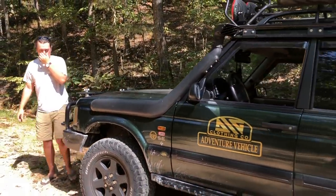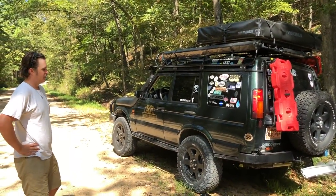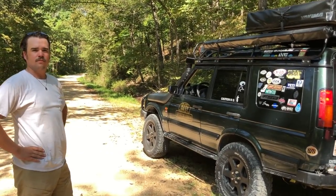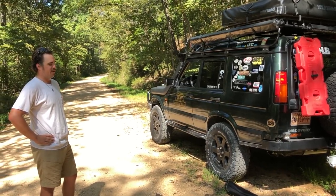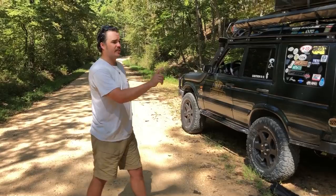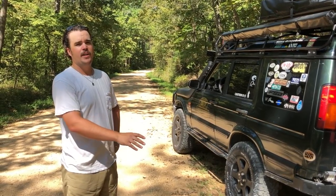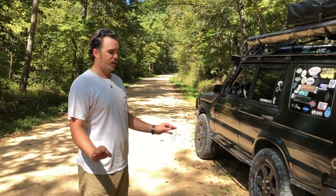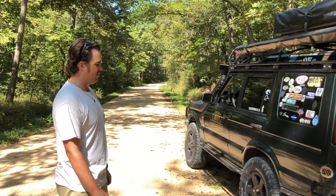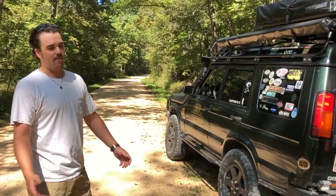I'm ready to see this thing on the trail. It looks so good and it's more than capable. What I like most about Peyton's build specifically is the DIY mindset — he's bought everything super discounted, reusing and repurposing stuff. One thing I didn't mention: this is a full traction control vehicle with a center locking diff. It does not have a rear locker or front locker — it relies solely on traction control and a central locking diff on the transfer case. It is extremely capable. People underestimate these a ton — this was one of the first traction control systems and one of the better ones comparatively for its era.